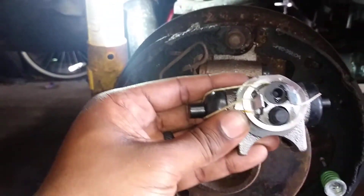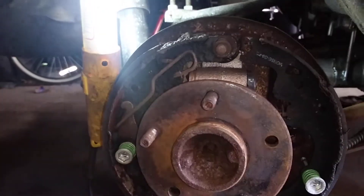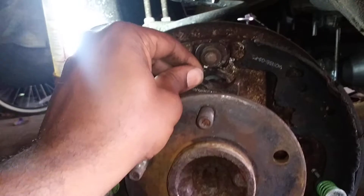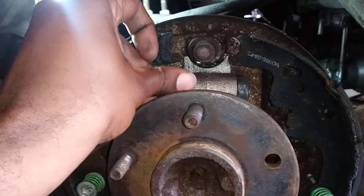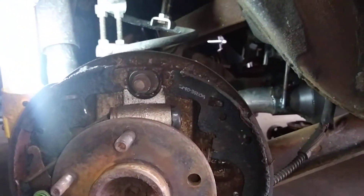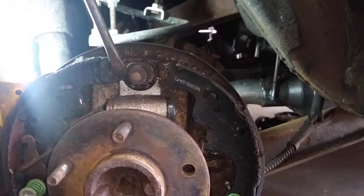This is the new one here. You got the silver bracket that's on the back of it that just locks in place. So instead of doing all of that, what I ended up doing was — this was in here like that. Spread the shoes open. This way you don't got to take it all apart. Take your nice little flathead and just push it right on back there.